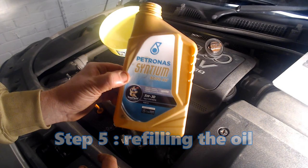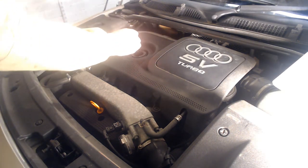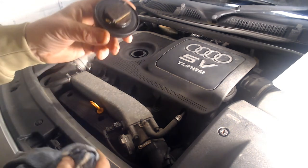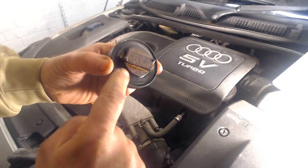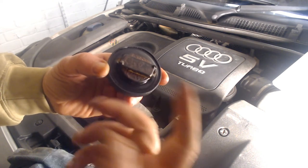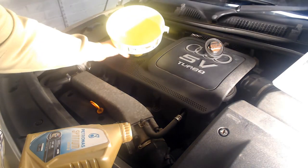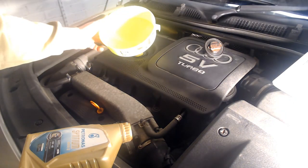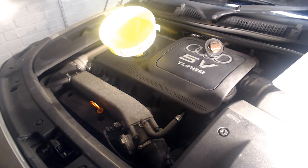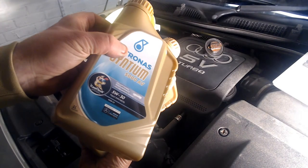To fill the car with oil it needs to be level so it is time to remove the axle stands. Next, working under the bonnet, remove the oil filler cap as shown. Inspect the filler cap for evidence of milky or emulsion like residue, this could be a sign of head gasket failure — mine is all ok here. Next, insert a funnel into the oil filler cap hole to make filling easier. The correct oil for my engine is this 5w30 fully synthetic grade. I have bought these 1 litre cans from Lidl as they were on special offer.